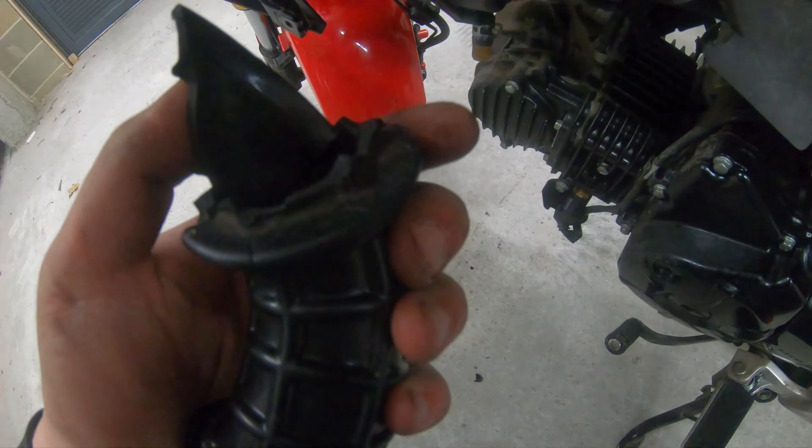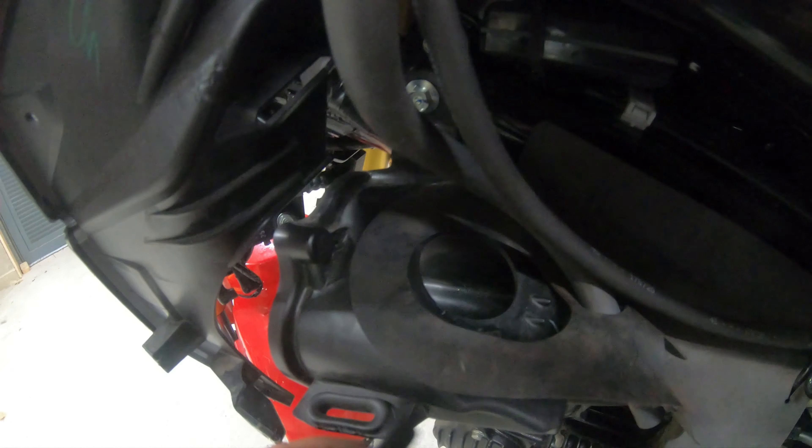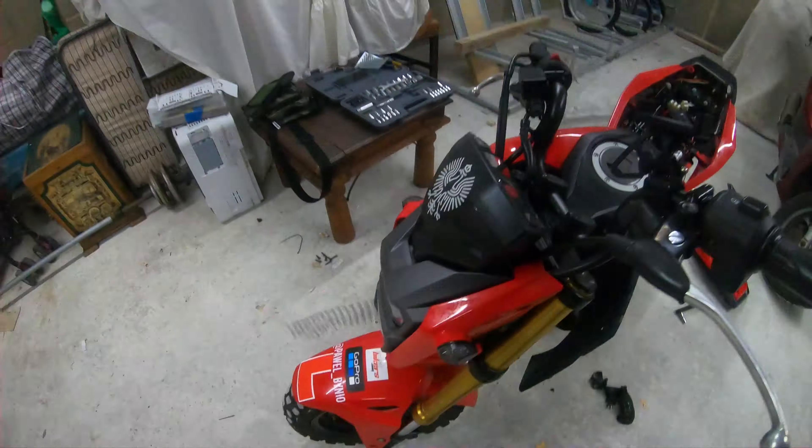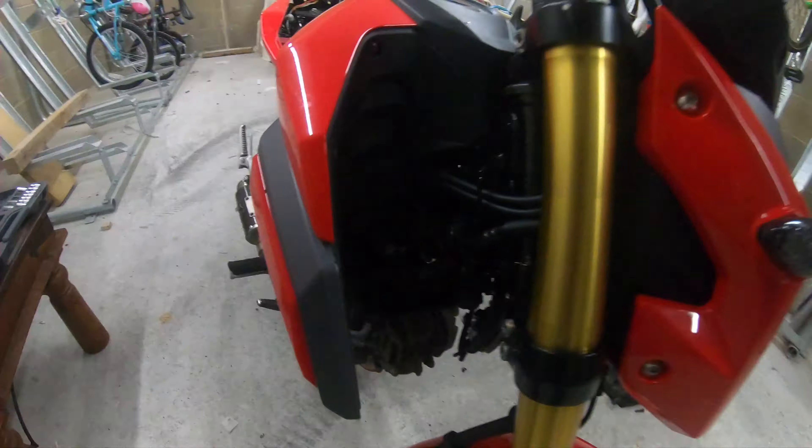After all those cuts I managed to take this thing through. On the older models this pipe comes in two parts and breaks off easier from the inside, but on the SF model you actually have to take off the side and cut it around and squeeze it through. Finally it came out. Now the other side — one more thing to do. You need to see this: there's a metal pin and a plastic pin — take that out, same thing for the top — and the pipe should split.